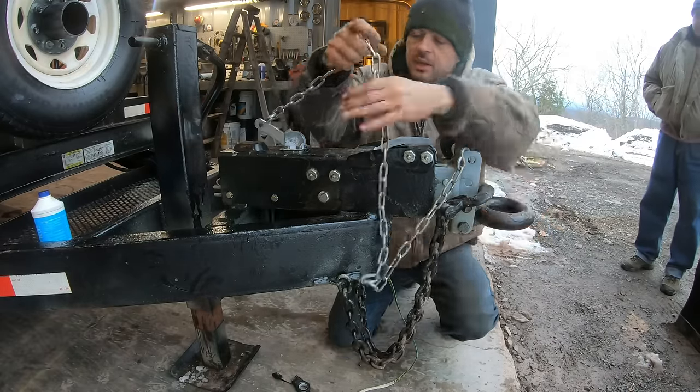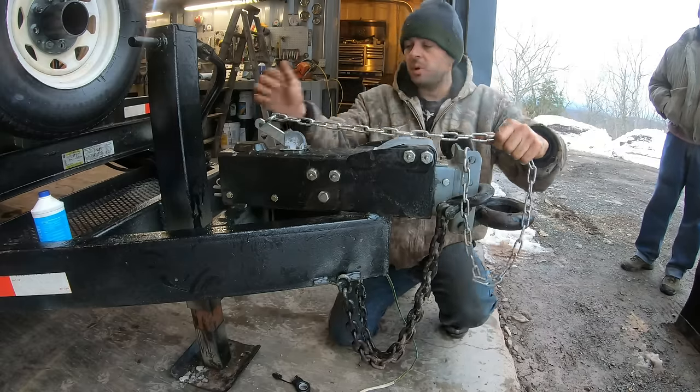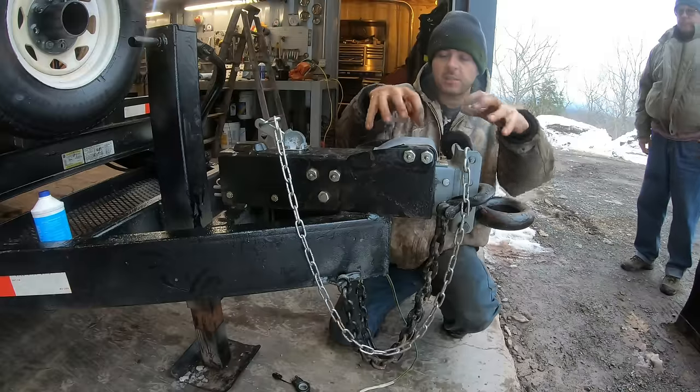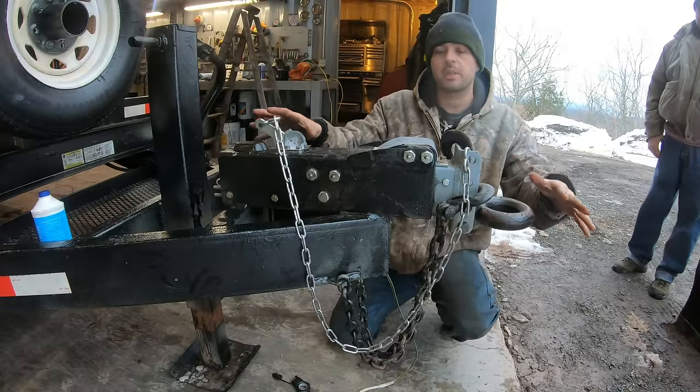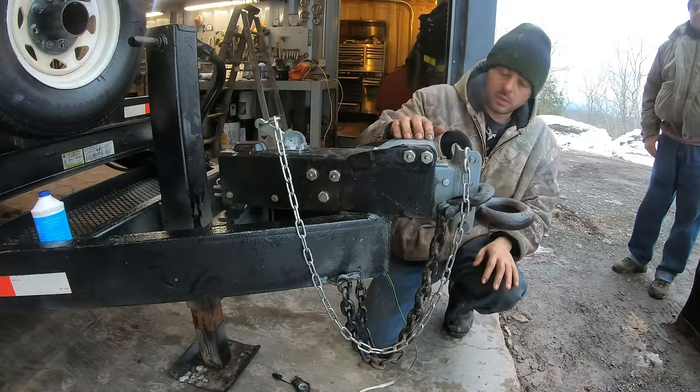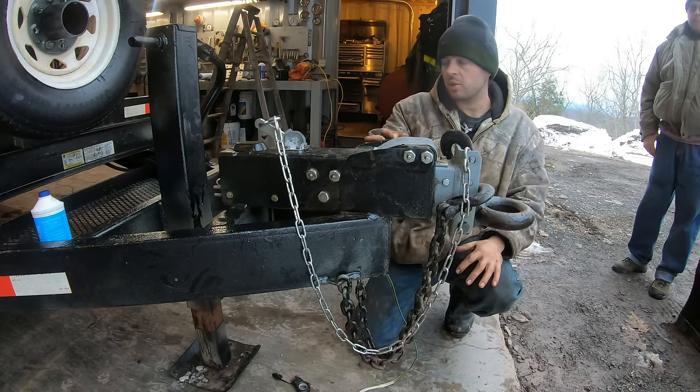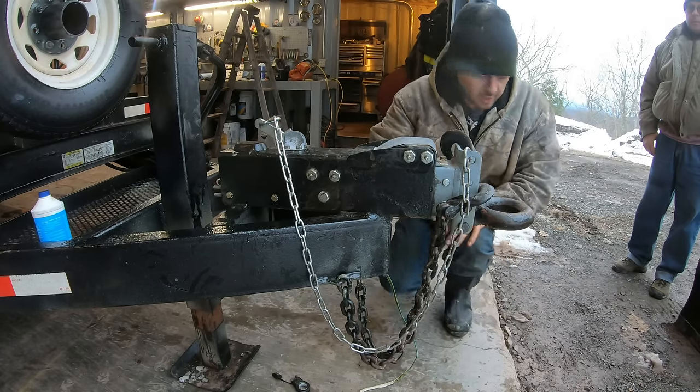And this is the breakaway thing. This hooks the truck. Once that gets pulled, it locks the brakes on. And I actually replaced this entire assembly. It didn't quite make that video, but the master cylinder wasn't priming, and then it needed a few miscellaneous little parts, so it was just cheaper to buy the entire thing.